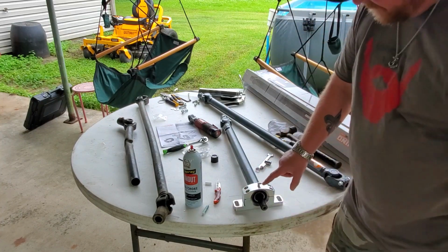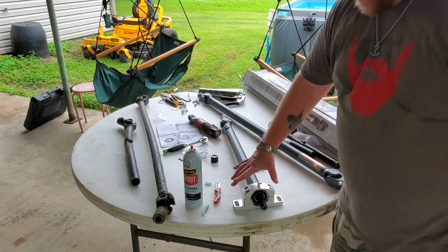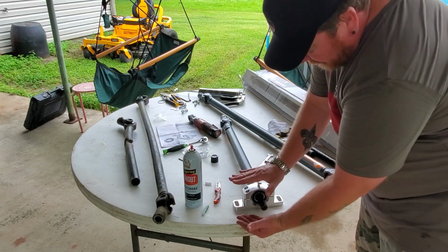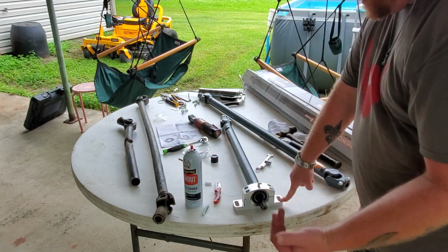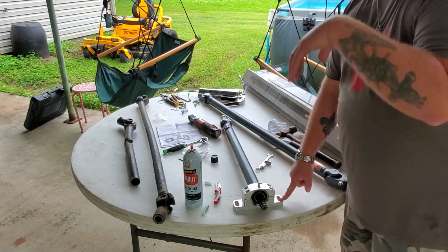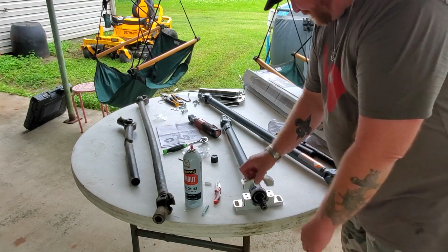And the Super ATV logo is gonna go towards the front. Now the hard part about this is this carrier bearing sits on top of the mounting bolts, and you gotta screw it in from the top. And you can't get to the top of them from the floor to the defender. You would think you can, but I tried to remove all the floor and you just can't get to it. So you actually gotta go in from the bottom.